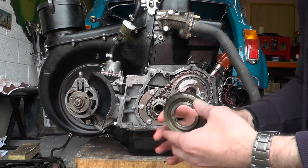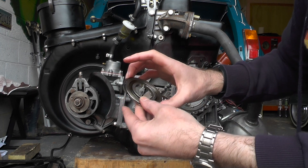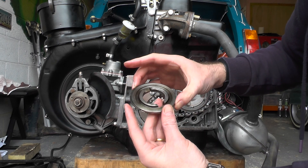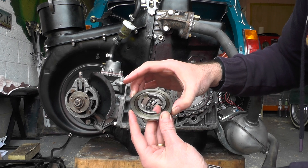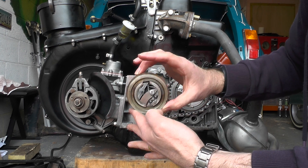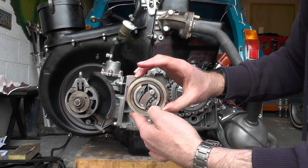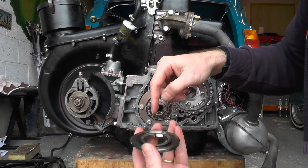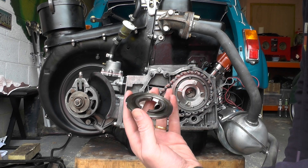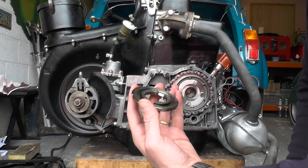What we found just behind this small cog on the crankshaft is a washer — it looks like this, and it's got a band around it which clamps together to allow it to sit in place correctly. I'd installed it facing this way, but unfortunately the way the oil system works, it needed to be facing this way in order for the oil to come into this channel and feed into the crankshaft.